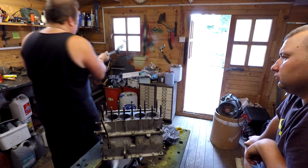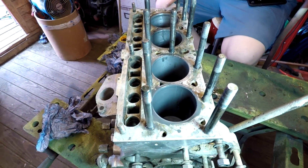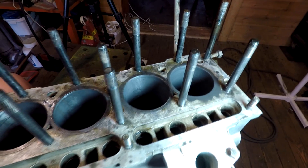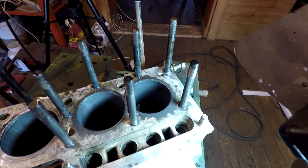That's the last pass. If you can see the sort of matte grey inside, that's where it's been finishing it off. I've not wiped that end one down yet, but as you can probably see there, it's a nice matte sort of surface now. I can't really get the light in there to show you, but that'll definitely take the new rings no problem at all.